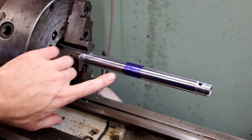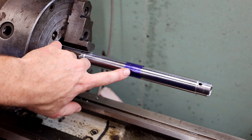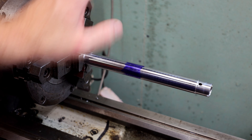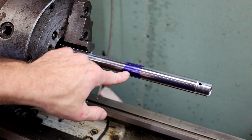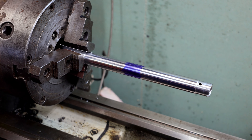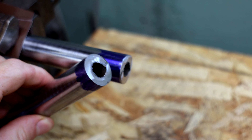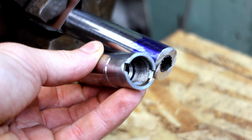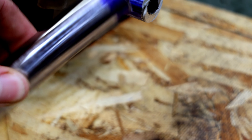Here's the shaft, and there's been no damage to it at all. I've got my shaft chucked up. I've got some Prussian blue on here and a small scratch mark. I'm going to start the lathe and spin it, then come in with a tool and mark that all the way around. That was cut off with an electric grinder with the lathe running a little bit, but as you can see, I'll have to bore that out. This is definitely a hard material.